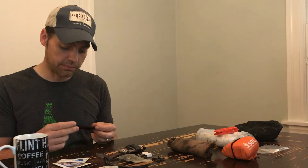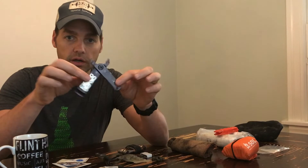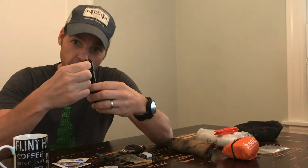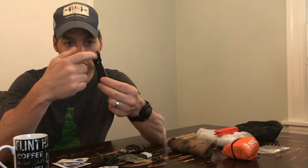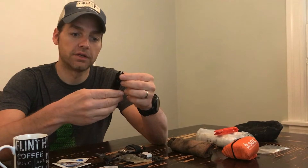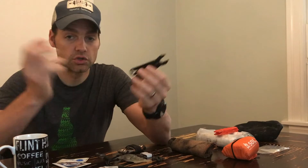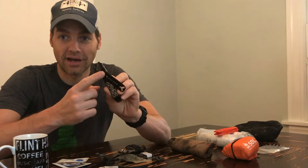The other sort of trick piece I picked up this year is this little pair of Master Link pliers that Wolf Tooth makes. Number one, it allows you to take apart a master link on a chain really easily. It also has a little wrench built into it. If anyone has ever had to swap a tube into a tubeless setup, the tubeless valve retaining nut can be a pain to get off — it could have been on there for a year or two. There's a little wrench built into the jaws of this tool that lets you get on there and twist that nut off. The other really cool part is that the pivot bolt is actually a chainring bolt, so in the event you shear off a chainring bolt, you can just use your multi-tool to take it out and throw it on your chainring.